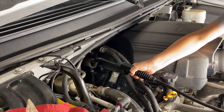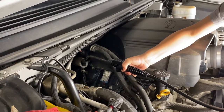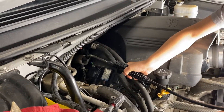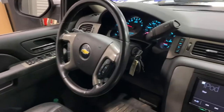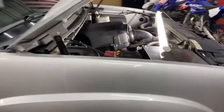Once it's up to operating temperature I'll add another — I'll post a photo — but it should be 6.7 additional quarts for a total of 12.7. Once we're letting it idle with the exhaust aimed outside and the trans temp gets up to about 120 degrees, we'll add that additional 6.7 quarts.